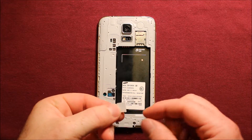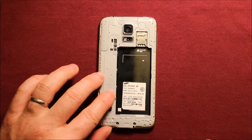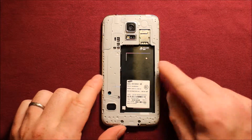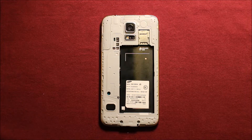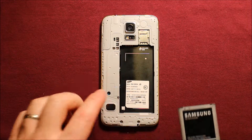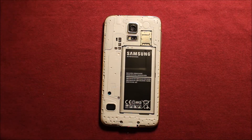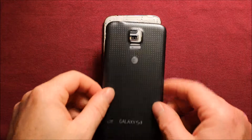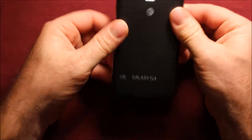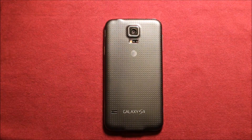Next, grab this little white piece and just set it right down here and make sure that it sticks down good. Then go ahead and insert your SIM card or microSD card if you have one. To reinstall the battery, see where the contacts are on the battery and the connectors on the phone — make sure you turn it the right way — and just slide it right in. To put the back cover back on, set it on top, start with the top, and work your way down around. Make sure it's fastened properly all the way around and you're good to go. Thanks for watching.